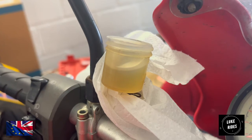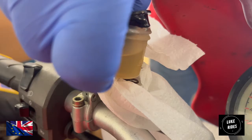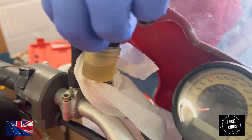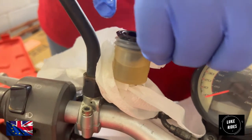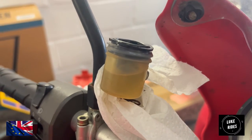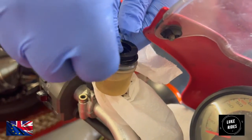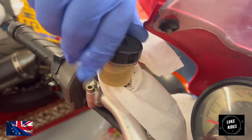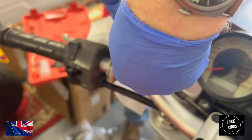Right, here we go. Diaphragm on and in and on. Okay, putting the diaphragm in. You'll notice the fluid level rise slightly. It's a nice fit, nothing's caught. The diaphragm also has this little plastic collar just to keep its shape. And then this is just the cap. Hold everything in place. I'm just going to hold on to it as I rotate rather than stressing.